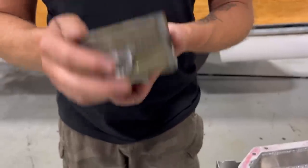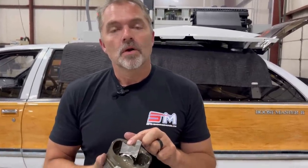This thing, obviously, in my humble opinion, has broken because of material, maybe something with the anodizing. I have a lot of people giving me a lot of good information there. I am having metallurgy done on it. We'll find out. And maybe a little bit of machining. I don't know, maybe a little bit of design. Absolutely, no doubt, that is a material problem for this horsepower. This thing makes over 4,000 horsepower. We will be making 70 pounds of boost. It needs to last more than 45 pounds of boost.